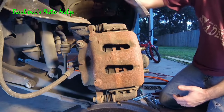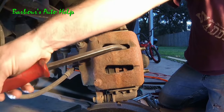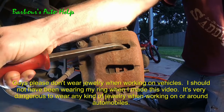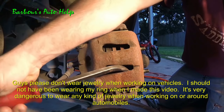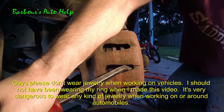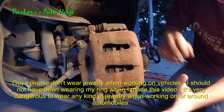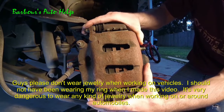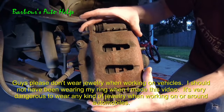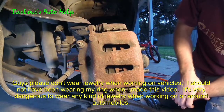First thing I'm gonna do is check to see if my pistons are seized up. The way I'm gonna do that is just take a pry bar, pry out on it a little bit, and see if it'll push in. It seems very, very stiff — yeah, that's pretty stiff too. They went in a little bit, and I get some side-to-side play with these slide pins, but they don't seem like they're moving, so we're gonna take this off and investigate further.